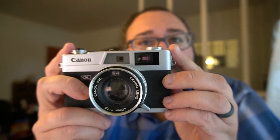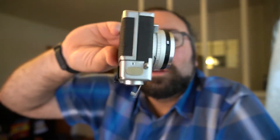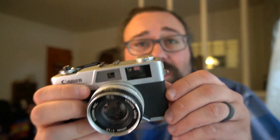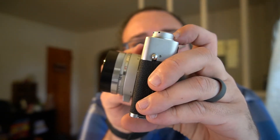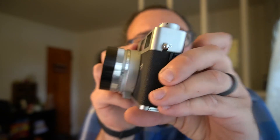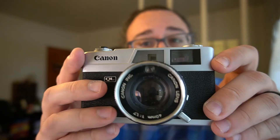With a little bit of know-how, they're pretty easy to take apart. Today I'm going to pull the top off this one, clean the rangefinder, and there's something going on with the film rewind detent lever — it's just flopping around, it should lock in. I think we're missing a spring there somewhere, which might be harder to solve than I'd like. This is the 25 — it just pops right up and out, there's definitely a spring in there. So we're going to look at that, and show you how to pop this top off and clean the rangefinder.